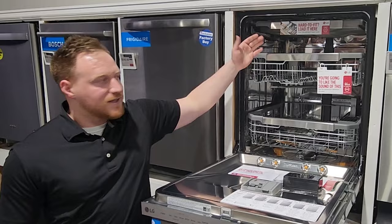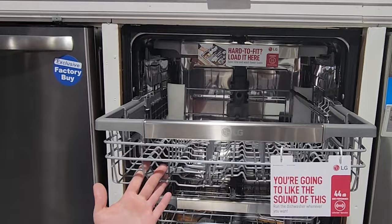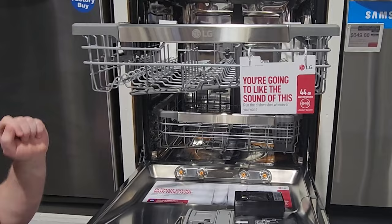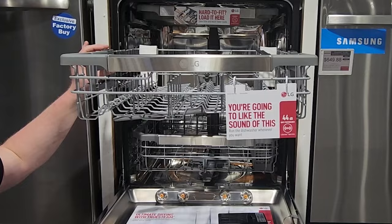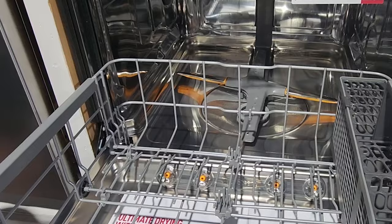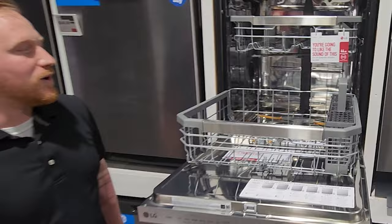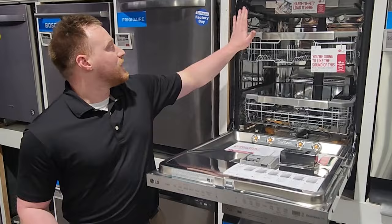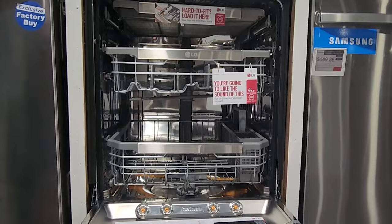Another cool upgrade on the mid-range model is that the upper rack runs on glide rails with ball bearings, helping it glide really smoothly. There's also some adjustability in the tines and a nice wine glass holder on the side. The upper rack is adjustable for height as well, so if you have something awkward in the lower rack you can move it higher or lower to fit. In the bottom, the tines are adjustable, and it still features the quad wash with direct drive motor for durability and quietness with oscillating sprayers. The key upgrades are the adjustable third rack, glide rails, steam functions, and 44 decibels noise level.